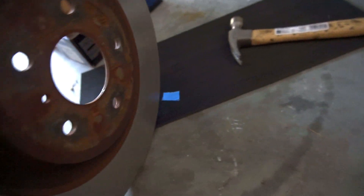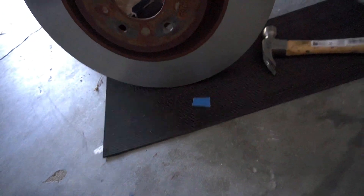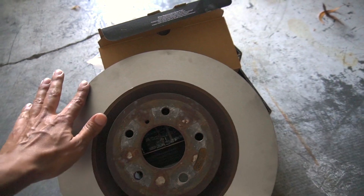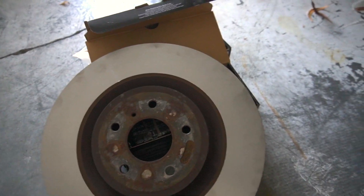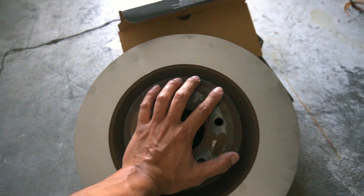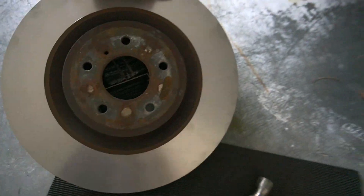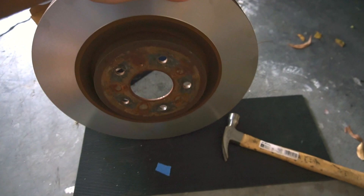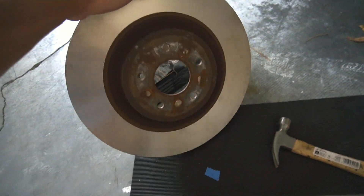I got the brake rotor back from O'Reilly's — it was about $12.50 each rotor. I only did the fronts as the rears were fine, and I'm going to keep the stock OEM brake pads back there for now. The fronts are at 31.45 millimeters so there's probably one good cut left in them, but these should last until the end of the year before I upgrade to the two-piece rotors.